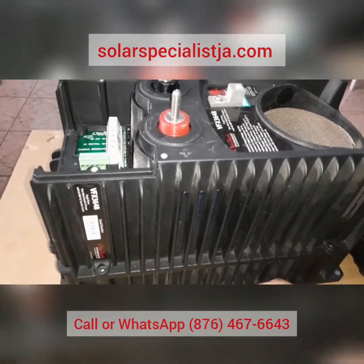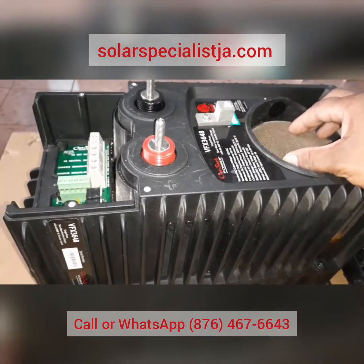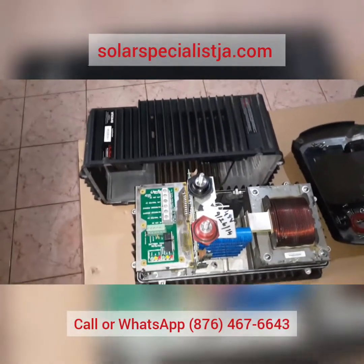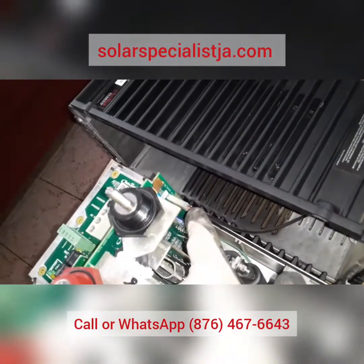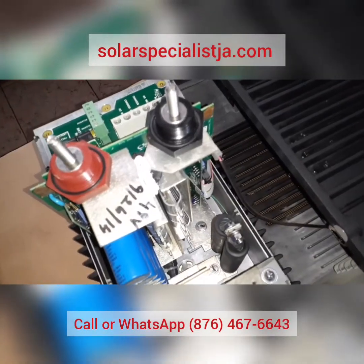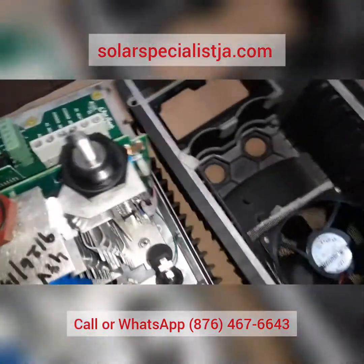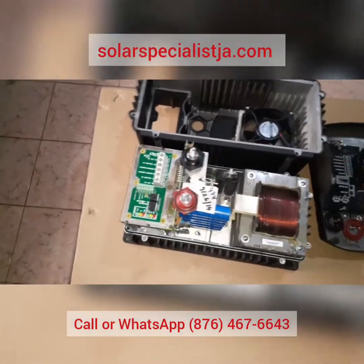Now a very important note: your fan is still connected to the FET board on the lower chassis, so you'll have a cord in between. You want to be careful to lift this very slowly. As you can see the fan is still connected to the board. To disconnect it, you just simply pinch it and it slides right out. And you've successfully removed the upper chassis with the entire unit exposed.